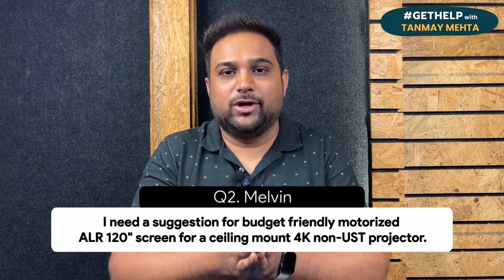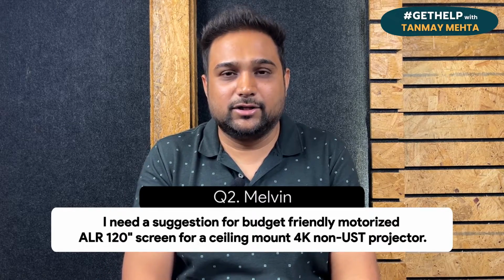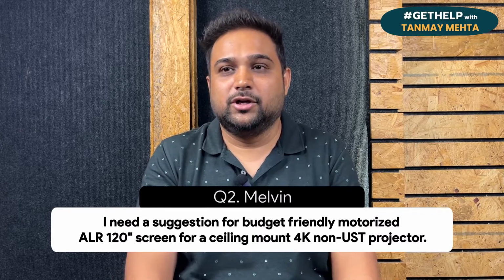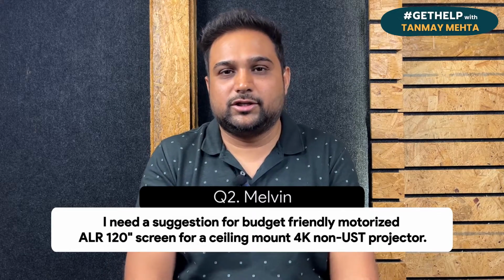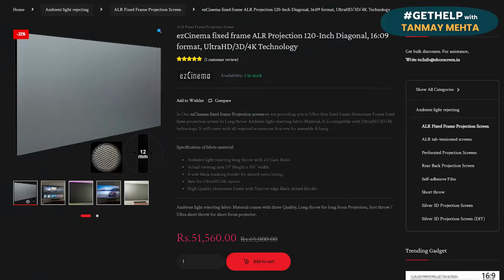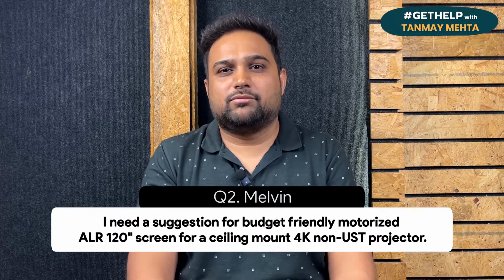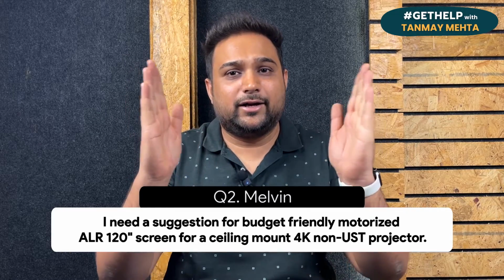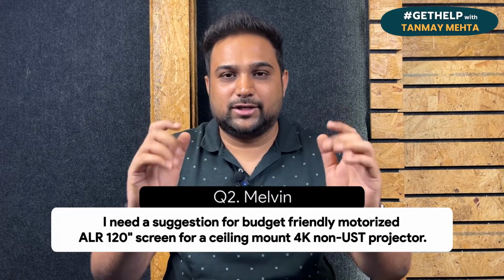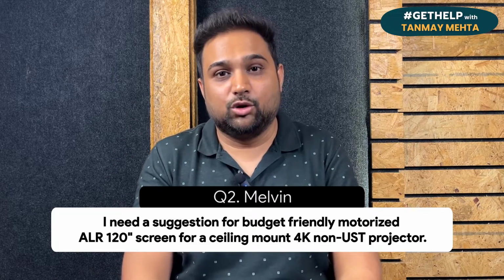Now coming to your question, Melvin, for a long throw ALR screen, the motorized screens, you can definitely consider them for your system. The ALR pricing, if I have to just give you tentatively for a long throw projection screen, it should be somewhere in the range of 50 to 75,000 based upon the screen size that you're going for and obviously the manufacturer that you're buying from. The second part is that all these motorized screens of long throw ALR are tab tension screens, which means that there are going to be strings on the sides which are going to stretch the fabric because the fabric is heavy and it requires a very nice tubular motor for it.